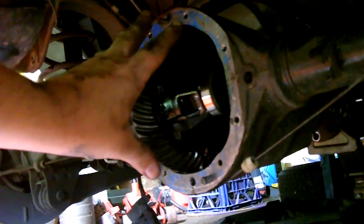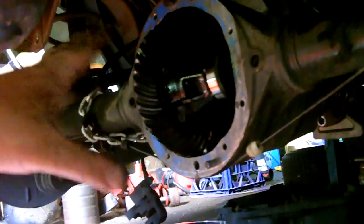When you've removed the four bolts holding the carrier in, you can't just pull the diff center out — you've got to spread the housing. The way I've spread the housing is using this chain arrangement: a chain going around that side goes out the front where I've got a jack — the actual scissor jack that comes with the car — and then chain around the housing on the other side too. By putting pressure on the jack at the front, I'm actually spreading the housing. It's a bit of a pain to set up, but it's the easiest way for a home mechanic. I would suggest don't try this at home — things under pressure, if they let go, can give you quite a nasty surprise.